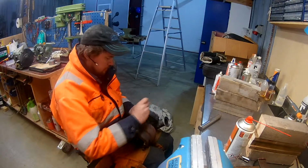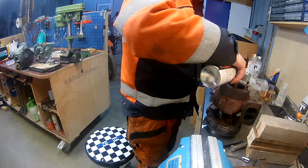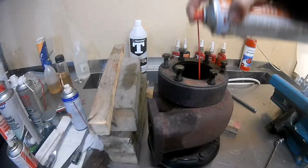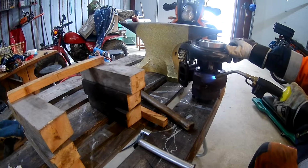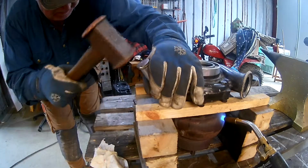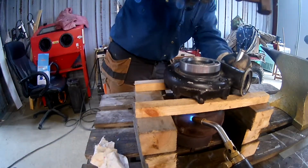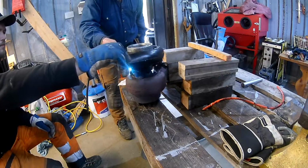And then I started spraying penetrating oil inside, as they suggest you should do for days, weeks, months, maybe years even. And I kept spraying for the next few days. Then a few days later some heat was added and did a few taps, did absolutely nothing. So kept spraying, kept tapping every other day, brought in some better heat with a proper torch.